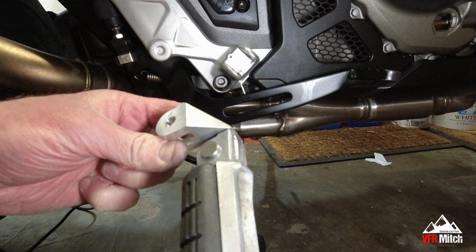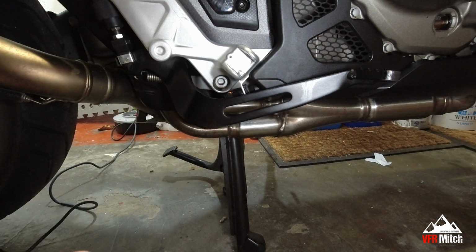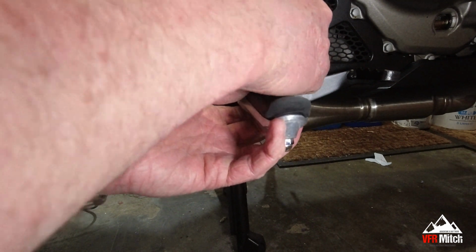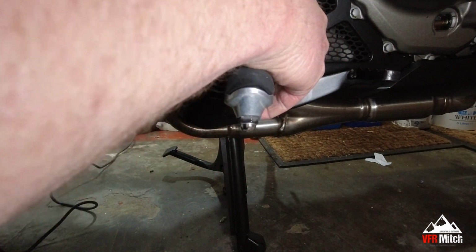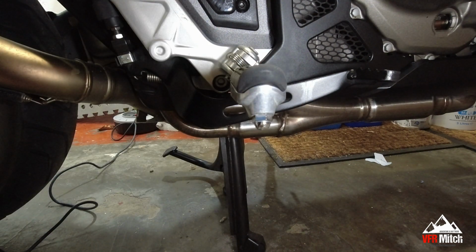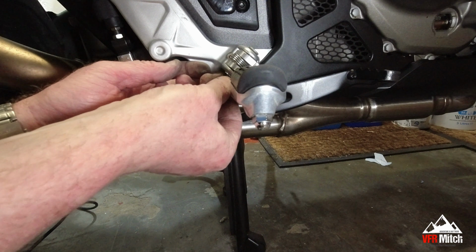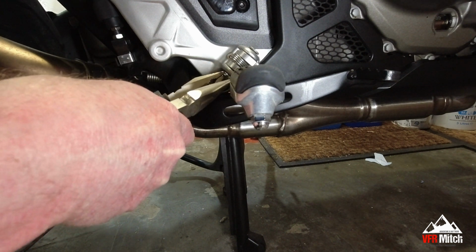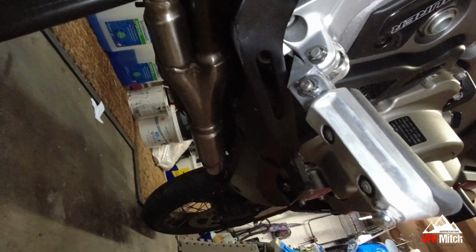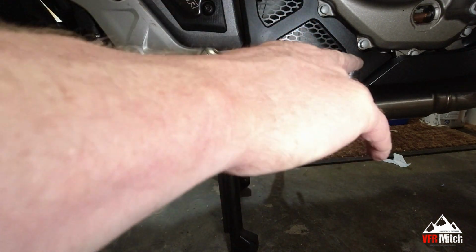We've got the adapter attached to the foot peg. I've retensioned my spring. Yep, that's down to the bottom. We're alright with that. Let's get the original split pin back in. That's tightened up under there. That's tightened up under there. That's lowered. It's just to check now to see whether the brake pedal needs adjusting.